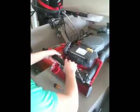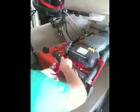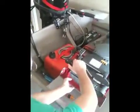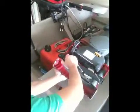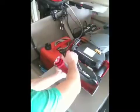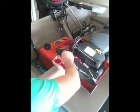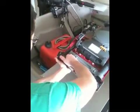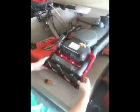Now, this is where it can get a bit tricky because these things are tough. What you want to do is firmly grasp as close to the belt as possible while trying to hold it on that thick spot with your thumb. Grab the front of the vacuum with the other hand so you can use both arms to stretch. Firmly pull and get it seated in its proper position. Then worry about the other end.